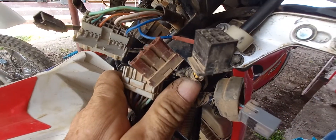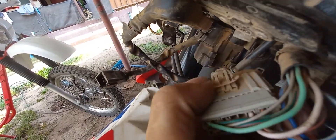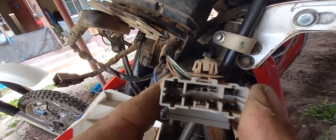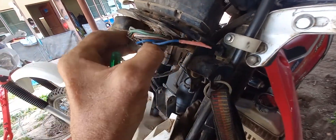We're gonna give those a good clean and a bit of a lube. To get those off, put a screwdriver in to get these little connectors off — you've got to squeeze the ears in while they're in their sockets. The only way to access those ears is right down from the top, one side at a time. Ease the ears in, pull the plugs off. They do actually slide off if you can get in there, but you won't be able to because that's facing downwards.